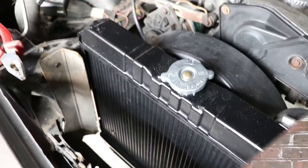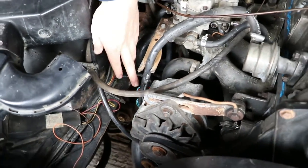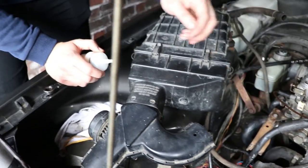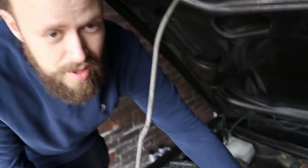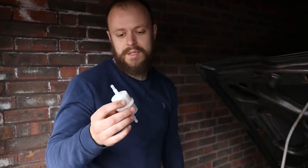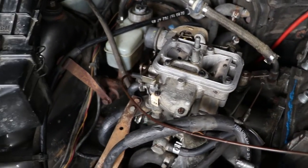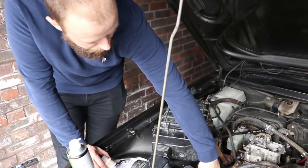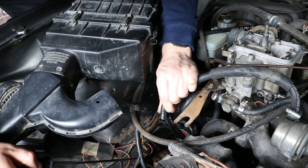There's also a little mod we're going to put on. It's an inline fuel filter. We did find a lot of sludge and small bits of rust in there, so we're just going to safeguard against that by adding this in. It's a pre-filter — can't hurt, especially after all that work on the carb. The last thing you want is to block it straight back up again. So just going to chop the fuel line and stick it in down there.